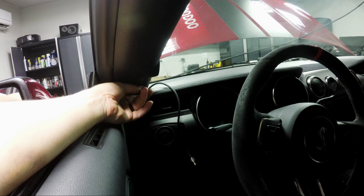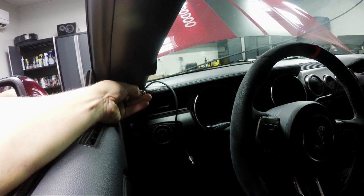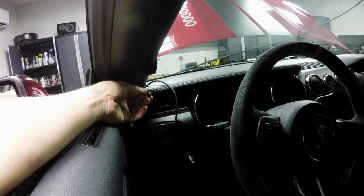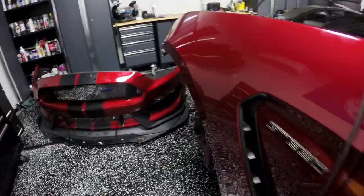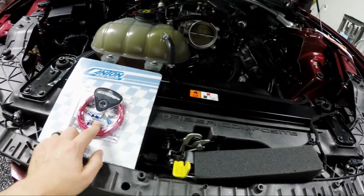Next up is the AccuSump light. I was using a little red LED to let me know when the AccuSump valve was opening — so when I turned on the AccuSump before starting the car, it would show red, and theoretically if oil pressure dropped below 37 PSI on track, the AccuSump would inject oil into the system. Unfortunately, it's just a cheap LED I got off eBay and I keep melting them because the amperage is too much for the wiring. So I ended up buying AccuSump's official kit — about $35 for some wire and a nicer, more robust LED.